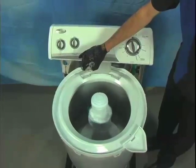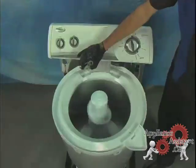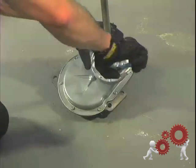If the tub is entering into the spin cycle and the water has been completely drained out but the clothing is still soaked, then it should be the clutch brake assembly that is most likely the cause, and it is examined more clearly in the drive system chapter.